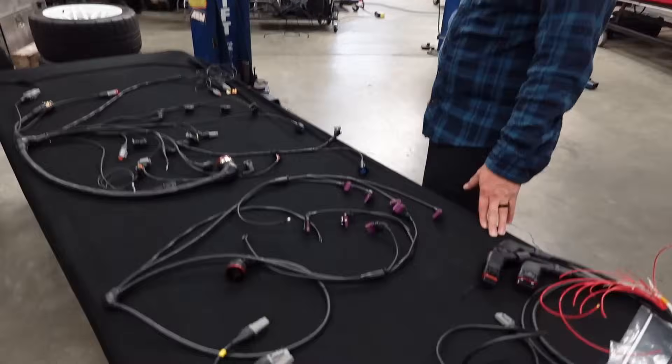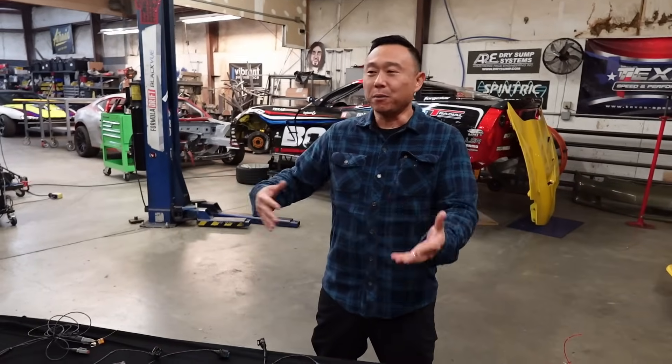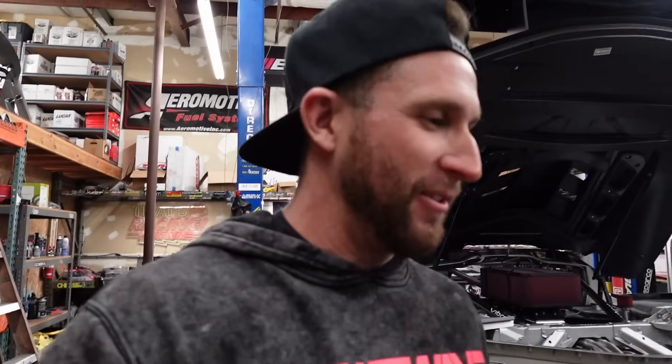I always try to. When building this car, Matt was telling me we're going to run the Voodoo ECU. And being that I'm responsible for the tune, I also want to be responsible for wiring the engine — that way it's just easier for me to know where all the inputs and outputs are. I've already actually built a starting map for this car. So as I'm creating the templates and the pinout diagrams, I'm also creating the base map to light off the car. I have it all in my head, I have it in Google Docs. I have printouts for Matt and the team so that when they need to diagnose or work on it, they have a reference to work off. And that's the proper freaking way to do things.